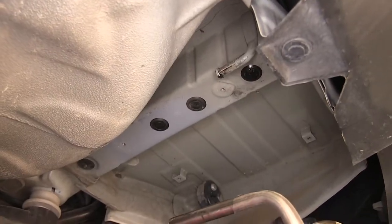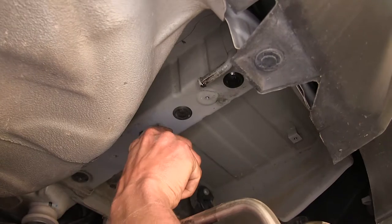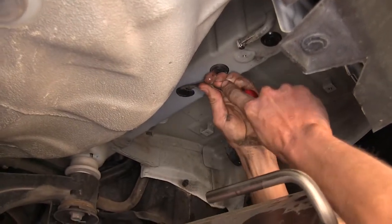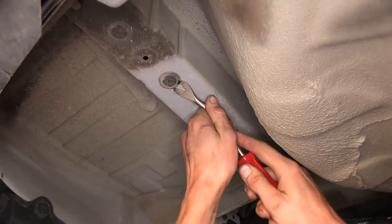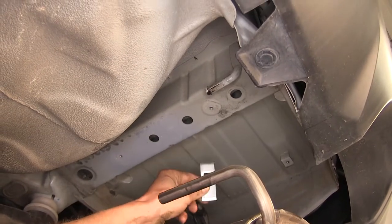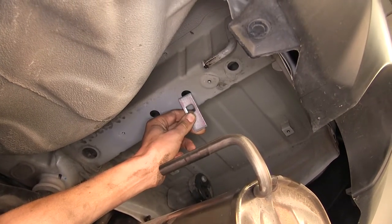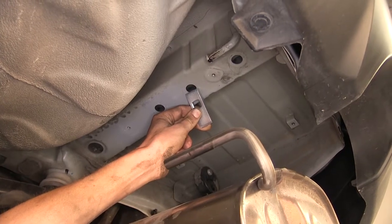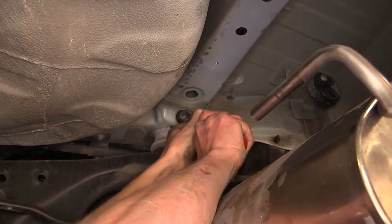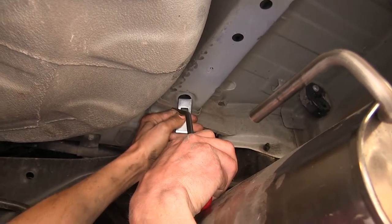Directly above where our heat shield was, we have three plastic plugs. We can pop these out with a flathead screwdriver or a trim panel tool — anything to get in behind it to pop it out. On the driver's side frame rail, we'll have the same thing, so we can repeat the same process — minus there's no heat shield. Now our carriage bolt spacer plates need to go through an access hole. The instructions say to use the middle one after you enlarge it; however, towards the front of the vehicle on both frame rails, there's another plug. Pop that one out and you can see it's a much larger hole, so there's less material you need to enlarge — we're going to use that one instead. You can use a grinder or, in our case, a step bit to enlarge it slightly so the plate can slide through.